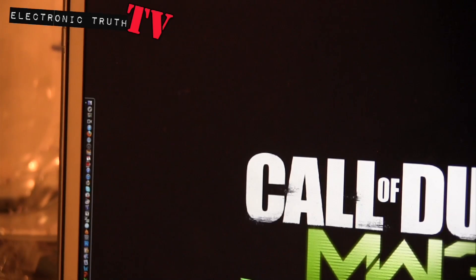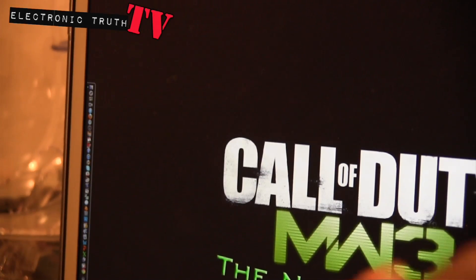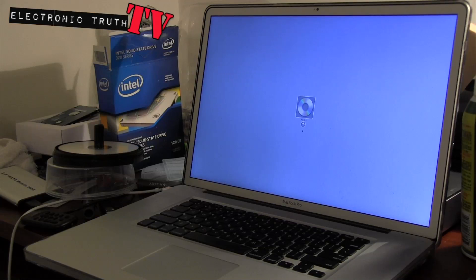So I'm going to go in and eject everything and I'm going to boot from — you guessed it — Lion. So I will show you: all I'm going to do at this point is pop in a Lion disc and that's going to be it. Once it's finished doing its thing I'll be back to talk about speed and all that other stuff, and then I will try the TRIM hack. Okay guys, I basically just popped in my copy of OS X Lion that I burned, held down the option key, and the OS X disc boot popped up on the screen and it's going to do its thing to this solid state hard drive, at which point I will start going in and turning off sleep mode and some of those other things that I do not need.